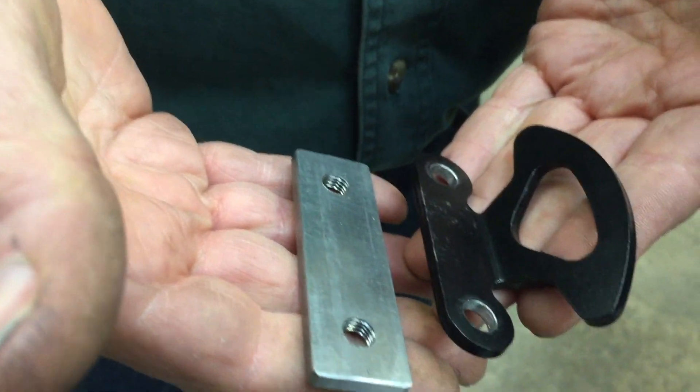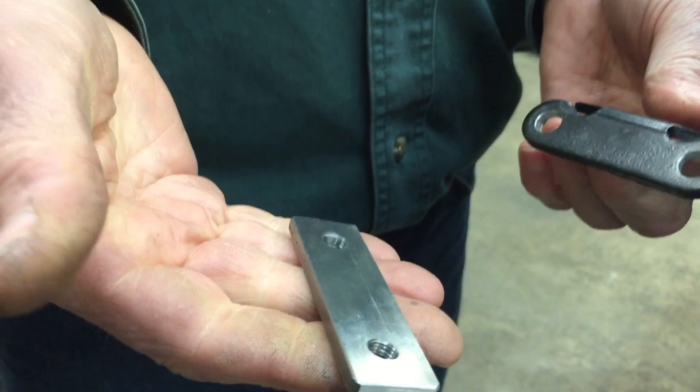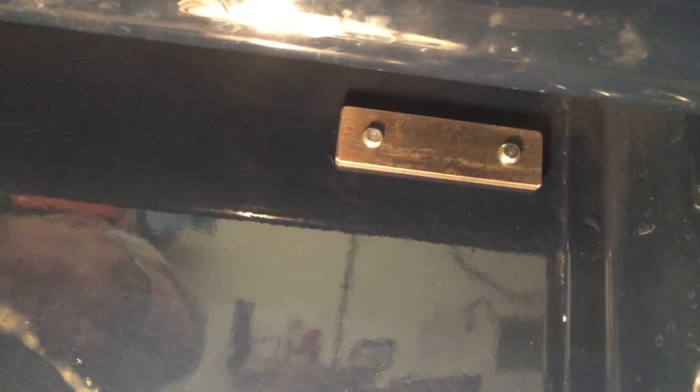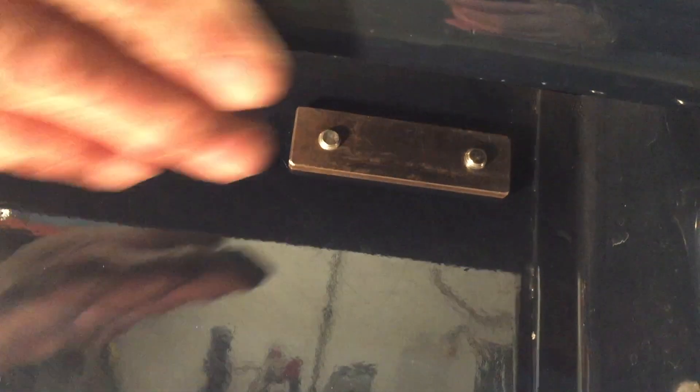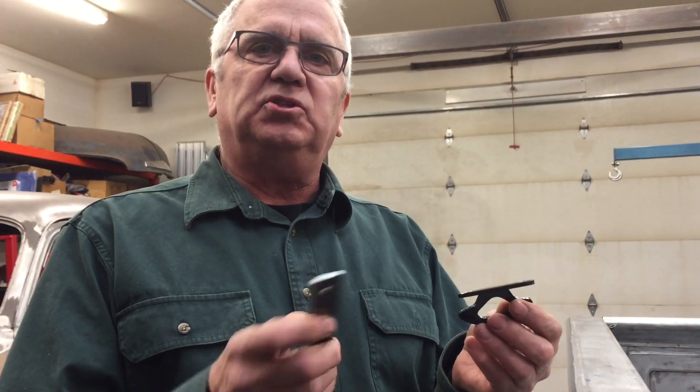Here's basically the design that I came up with. This is your tie-down here, pretty simple. I just took a piece of 3/16 flat steel, drilled and tapped some holes, and then the finished product — let me get a light under there — it's pretty nice and clean. I'm going to paint that to match the bed so it'll really disappear. I tucked it up under the lip of the bed, so it really doesn't show unless you're getting down on your knees and looking under the bed. So let's head over to the workbench and I'll show you what's going on.